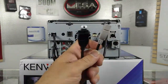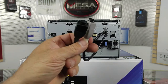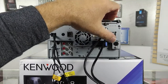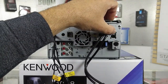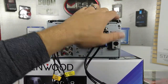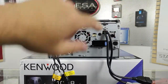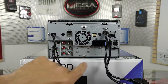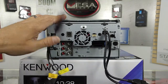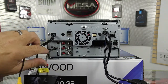One thing that has changed this year: it actually comes with standard USBs, which they did not do on the other four models I mentioned. There's gray for phone and black for USB. These two inputs down here are for your Maestro module — if you're doing an iDataLink Maestro module, these are the ports you'd use. This input here is for a satellite tuner. Under here we have the standard power port, three 4-volt pre-outs — front, rear, sub — and of course your antenna input. This AUX out would be for audio if you're using dash cam video.